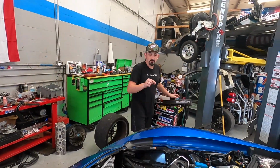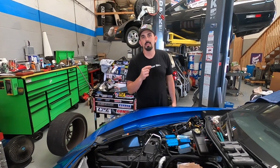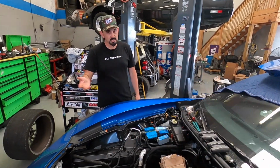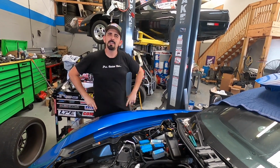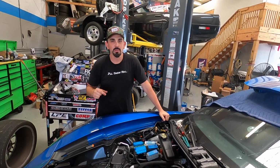So the cam has a fuel lobe for the mechanical fuel pump. It's got a 32% larger lobe for the high side fuel pump. So just like the camshaft would have a different lobe, except it's a triangle. And it's got 3 big lobes, so they're 32% bigger.